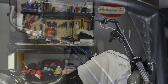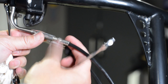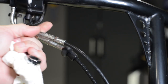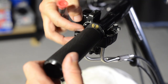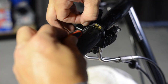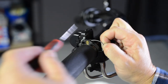You can now roll back the rubber shielding to gain access to the throttle and idle cable adjusters. Release the lock nut and back off the adjusters as much as possible. This will give you the slack you need to remove the cables from their connection points. Turn the throttle a bit and it should give you plenty of slack to help remove the ferrule nut from the throttle grip.